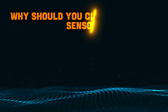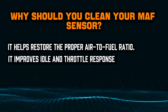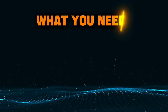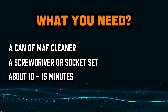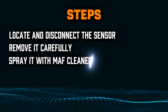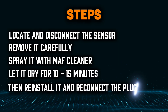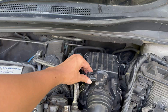Quick recap. Why should you clean your MAF sensor? It helps restore the proper air-to-fuel ratio, improves idle and throttle response, boosts your fuel economy, and can even prevent false error codes. Here's what you need: a can of MAF cleaner, a screwdriver or socket, and about 10 to 15 minutes of your time. The steps: locate and disconnect the sensor, remove it carefully, spray it with MAF cleaner — no touching, no wiping — let it dry for 10 to 15 minutes, then reinstall it and reconnect the plug. Quick, easy, and one of the best little maintenance jobs you can do yourself.